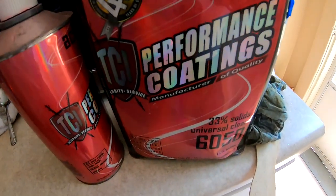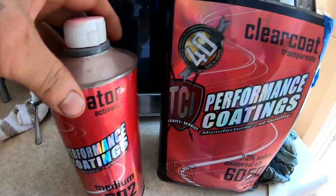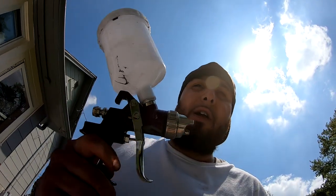I'm gonna be using this clear coat right here with some activator. I've tried this before and every single time it always wrinkles — it always has some kind of a reaction. The only time it doesn't do that is when I actually use the clear from the can, but in my case I don't want to use the clear from the can, I want to use it on a gun.